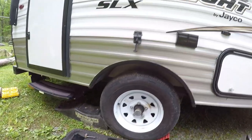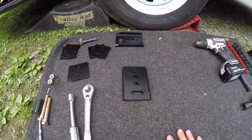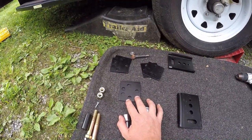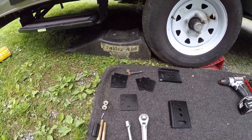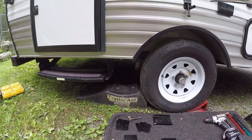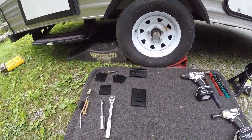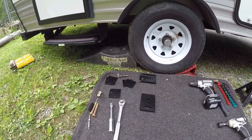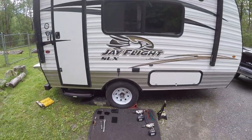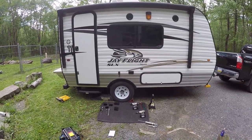You'll see the tire wear when I take the tire off. It's a simple little kit to install. It's got a couple of brackets that extend the leaf spring perch down, then gives you some different brackets with a couple of different alignment holes — you can move the axle forward or backwards up to about a quarter of an inch. I already did the other side, so I got some of the hard work done. This side should be the easy side. I ran into a couple of snags on the other side because it's such a small camper there's no place to place the jack.